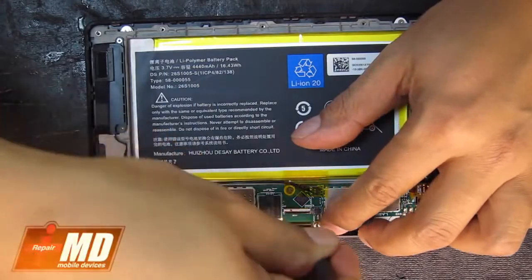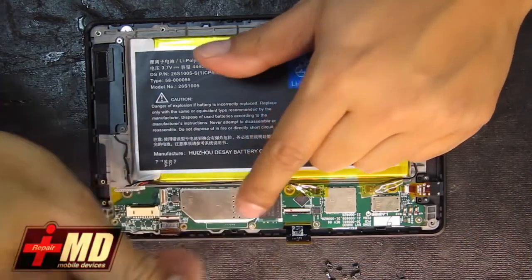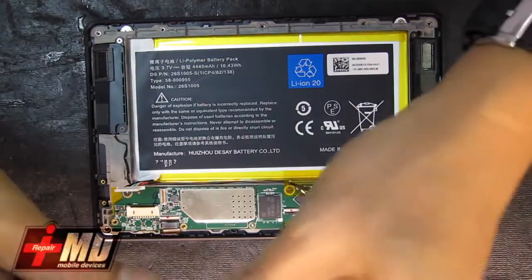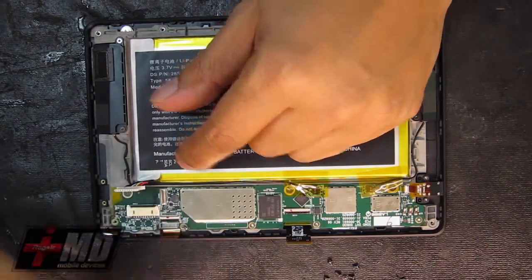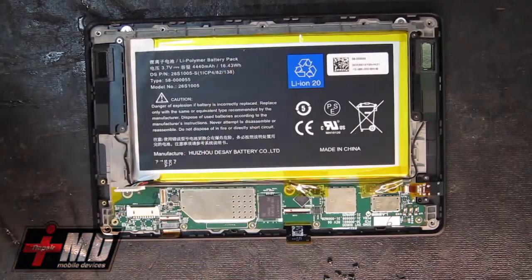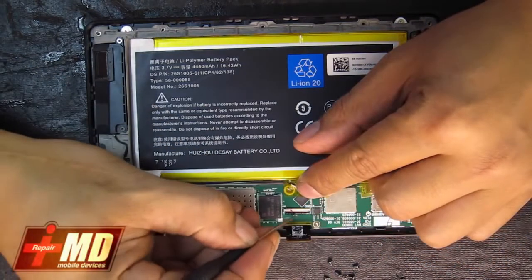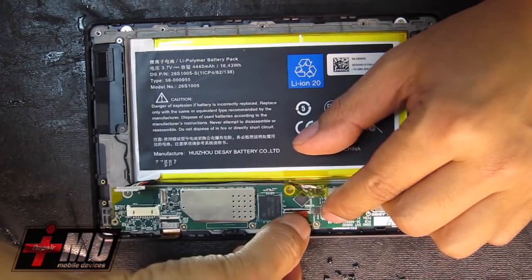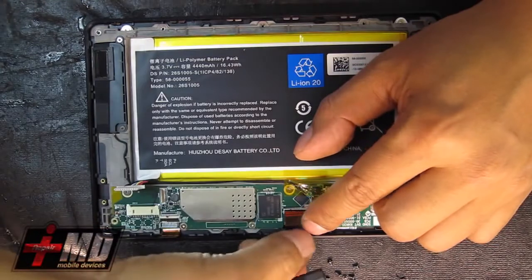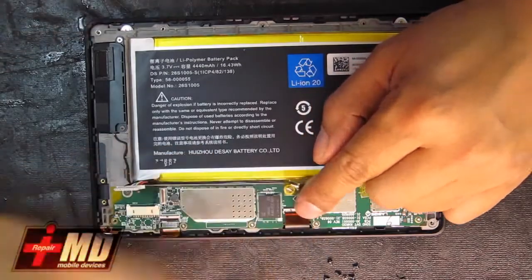Let's go ahead and tighten all these screws. Circuit board lock. These are the clear ones. The chrome screws. All right, go ahead and put the flex cable back in. Make sure you pull the tab up before you lock it. There's a black line indicating where it should stop. Make sure it's all seated carefully, and this is for the digitizer. So it's nice and seated now, so go ahead and lock it in.